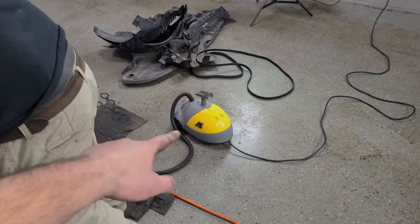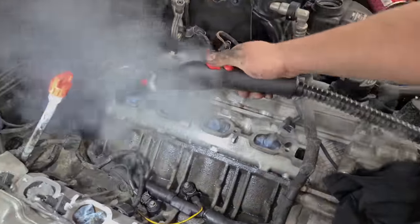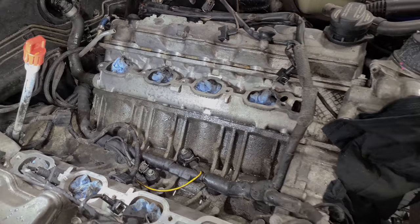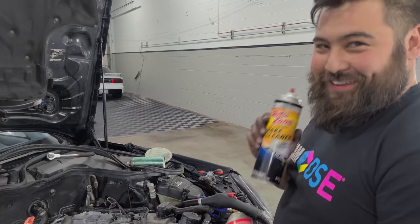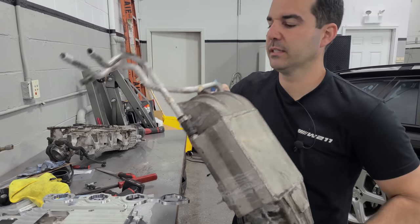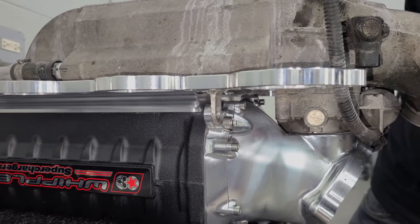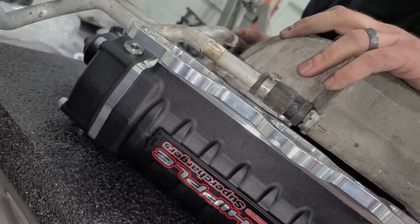This is it — guaranteed. That's precisely how much you needed to shave. I don't know the exact measurement; it was about 10 rounds of shaving. Let's get this guy in here — it's totally going to work. Nice, look at that — you hear that? Beautiful. Now this is looking like it's going to go down. One thing I noticed, which is a big bummer as far as getting this fully assembled on the engine, is this harness — it's super brittle. This is for the bypass valve, so if we needed to replace this later we'd have to take the supercharger off.